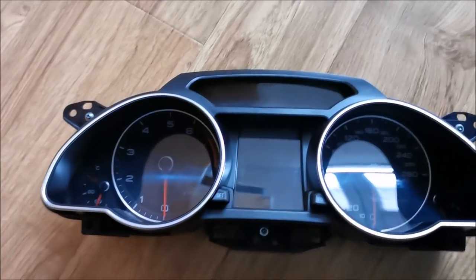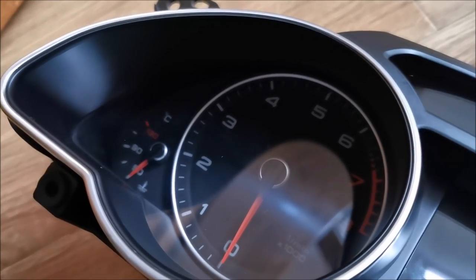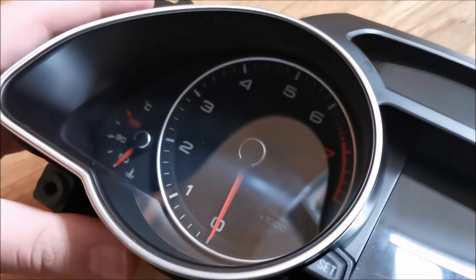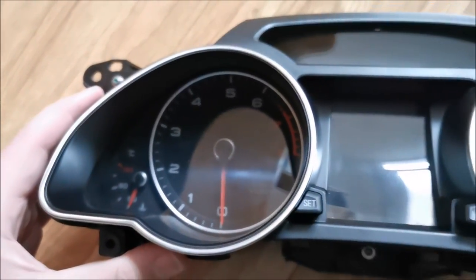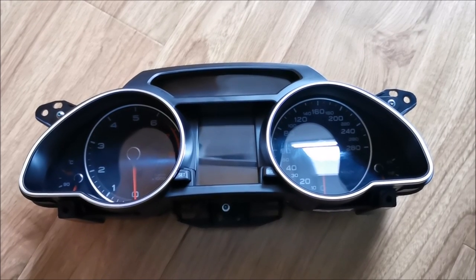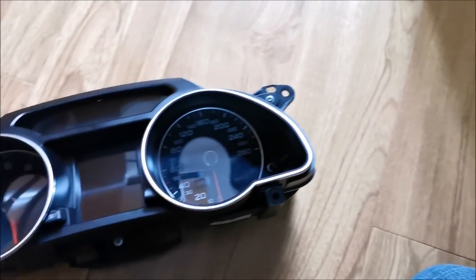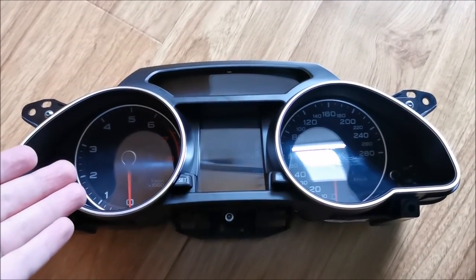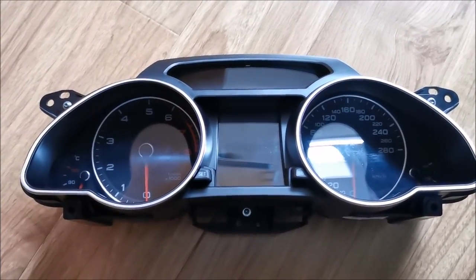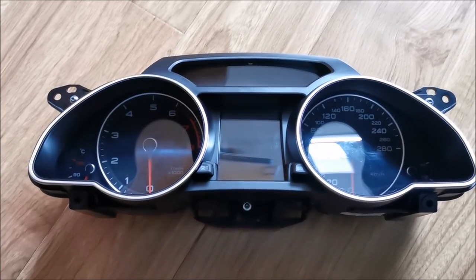I finally did it. I love how this thing is looking, and yeah — zero chances of somebody figuring out that we have something painted down there. I'm quite happy how this thing turned out. Let's see if we can actually install it inside the car. Obviously put the screws back in — T10 Torx again. Some would say to test it before it's closed, but I found the stop for every needle so they are exactly in the same position I took them from. I think it should be okay — I'll try and put the screws and see what happens. If I'm lucky, all is well.